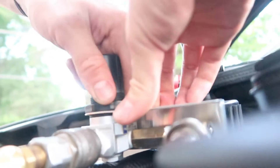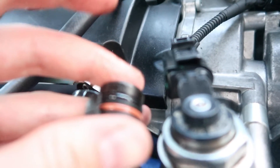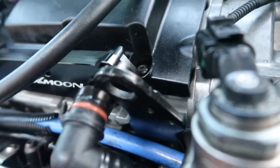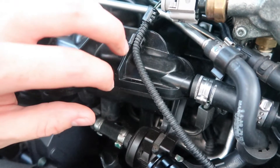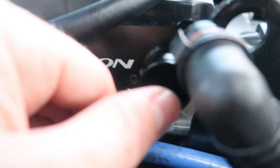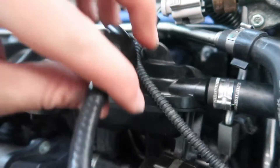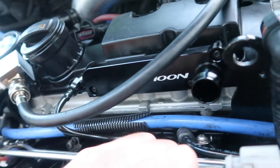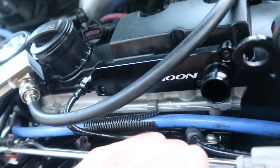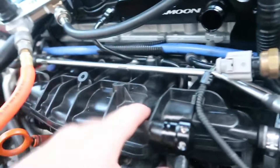Alright here we go, unlock this guy. For this one I can feel the pressure coming out of the valve cover — a little bit coming out of the crankcase. Not really actually, so the pistons are sealing well. It's coming out of the valve cover, which I assume means it could be coming past any of the valves. I don't feel it coming from the intake — I do feel it coming from the valve cover, which is kind of weird. So it must be coming out of the exhaust — definitely right there. I didn't hear anything coming from the intake manifold or the exhaust. The valve cover is only connected to the head, but for pressure to get up there it would have to get past the valves and the valve seals.